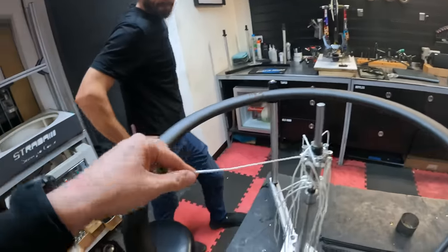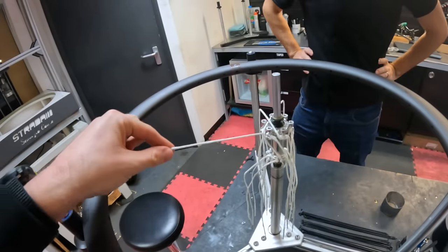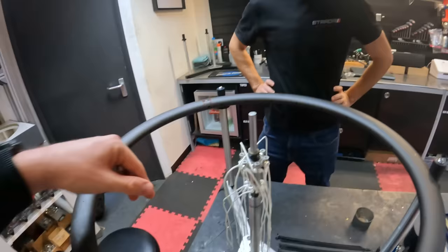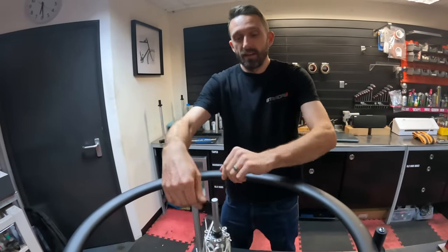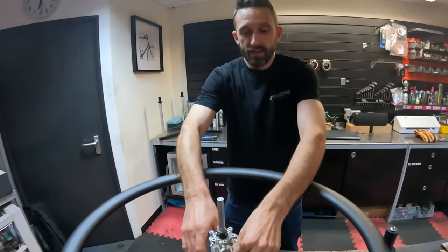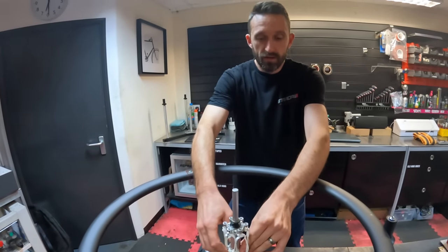Johnny is a wheel builder so he knew exactly what he was doing — he's a good tool maker, and nowadays he's probably a better tool maker than wheel builder, but back in the day he was doing it full time like us. His jigs are spot on. So basically now the goal is to get these spokes into the rim. Because it's string you can see it looks shorter — so we've got to find the right lacing pattern, get them in line, and then start firing them in.